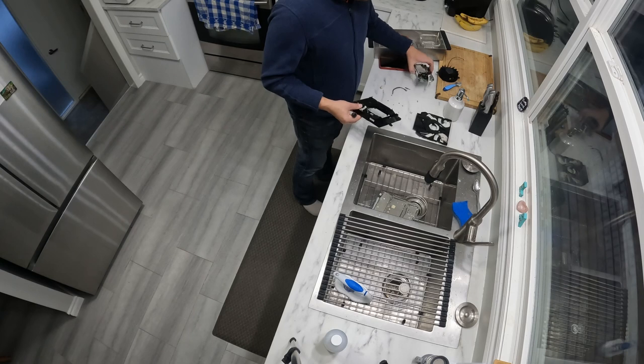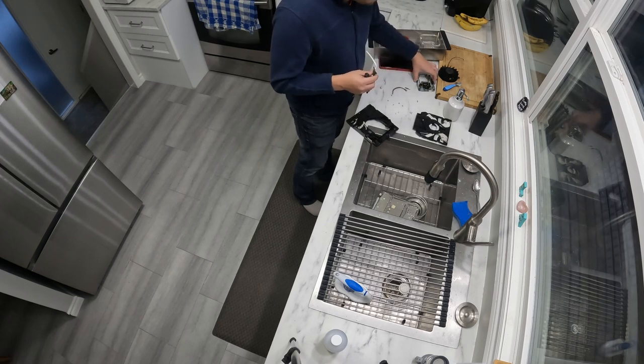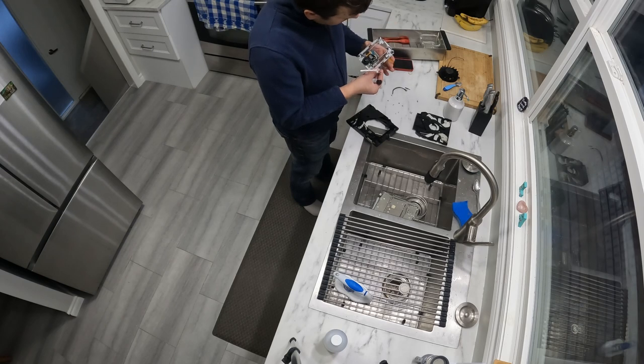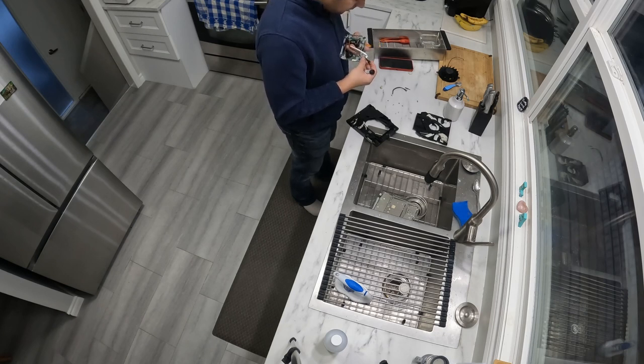I'm putting the screws back in that I took out from the gear feed and switch position sensor, as well as the gear that I took out with the screw on it, so I don't lose track of where they went. Now that all the electronics have been removed from the bottom shell of the Blu-ray drive, I can put those away and give the bottom shell a scrub down.